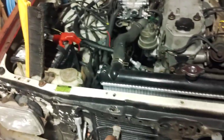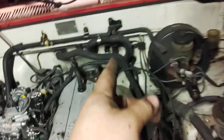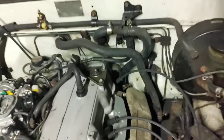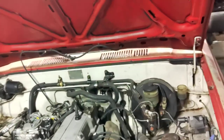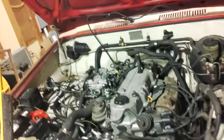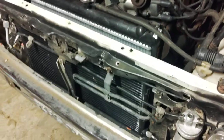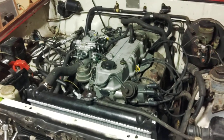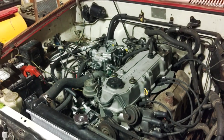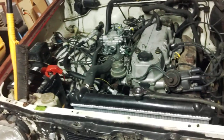These AC systems suffer from poor performance because the condensers get worn out. Watch this heater valve here — these get stuck in the open position often, especially on non-AC trucks, because people will just crank it over and leave it. Make sure that's working, because if not it won't cool as well. Make sure you have foam around the condenser, a good fan clutch, and a good fan shroud. These compressors often wear out, causing the AC to be mediocre at best in the summer, which makes people mad.